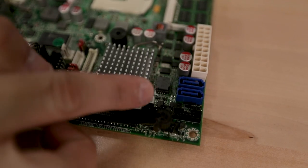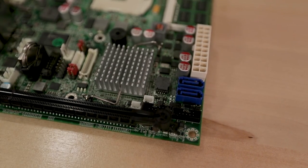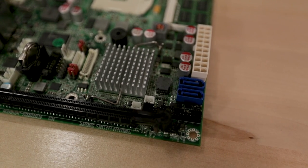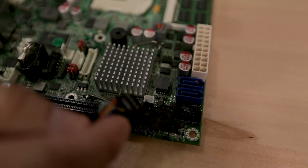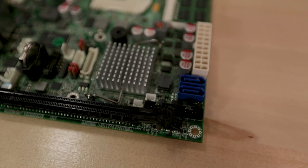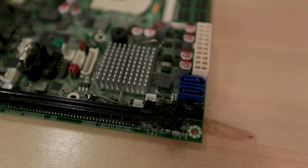So the pins here, as you may notice, well, first they put this stuff in there for shipping, I guess, that's supposed to protect the pins, whatever. I had to pick some of that out. That was the first obstruction. But second, a normal USB header does not plug in here. You can see this is way bigger. This is a whole different size. This will not fit there. That is called a different pitch. These pins are a different pitch than your standard USB header pins.